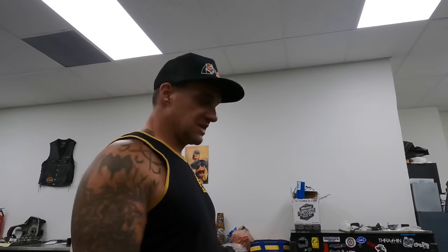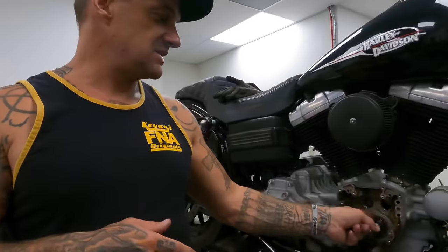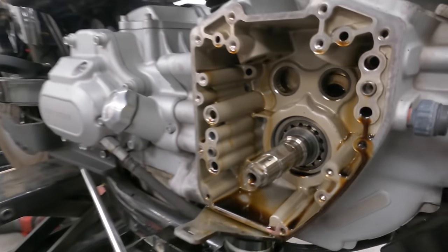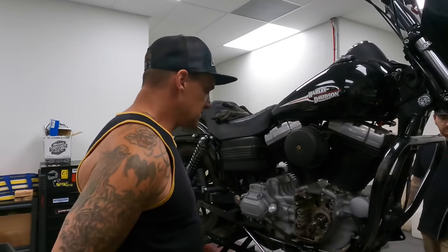Buying a bike just because it has a Timken bearing in the bottom end is not going to make that bike any better, because the bearings aren't normally what goes to shit — it's the side play, the wheels slipping because the pin is just a press fit. When you're banging gears, those heavy flywheels go and they walk, and then you're rotating all fucked off — you get a bunch of shake and vibration in the handlebars. I've only actually seen a crank bearing fail once in a twin cam: someone built the motor without the retainer in, the bearing walked out of the case into the cam plate, broke the oil pump into four pieces, and destroyed the motor. When I contacted that motor company, they gave me $200 for their warranty — I was like, yeah, fuck you.